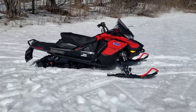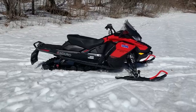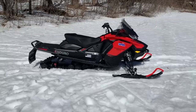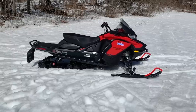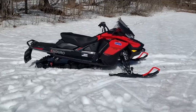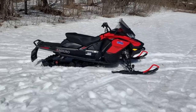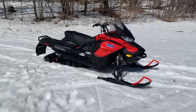The engine performance is great - it's just the throttle. Once you're past about halfway to two-thirds on the throttle, everything seems to respond okay. It's from throttle tip-in to halfway throttle that gives the unpleasant experience. If you put time in on it you know what I mean - it's kind of that rubber-band feel. You get on the throttle, you're blipping your thumb the way we all ride a snowmobile, and it just surges a little bit after you expect it to. It's hard to get used to.